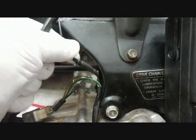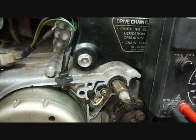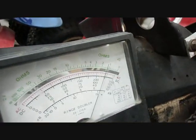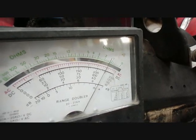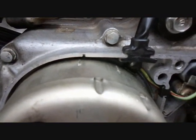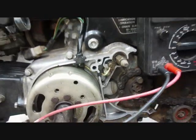This black wire coming out of the magneto is the one for the ignition. There's another black wire down here that's not used. Connect the meter lead here, position just to the left of the F mark, and as you move around to the F you'll see the meter move. The meter moved right there — and the F mark is lined up, so the point gap is correct and the timing is also right. The way you set the timing is by adjusting the point gap. There is no separate timing adjustment on the ATC-70.